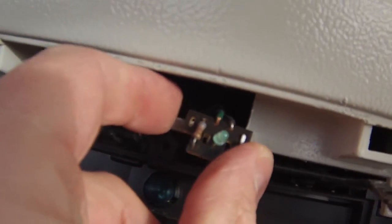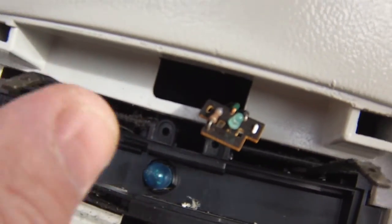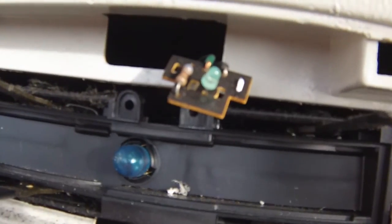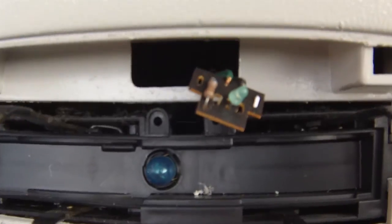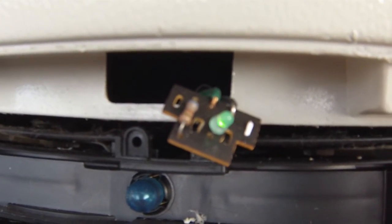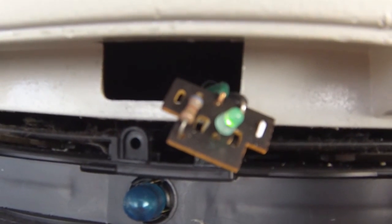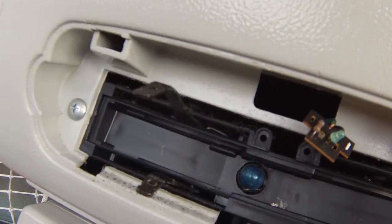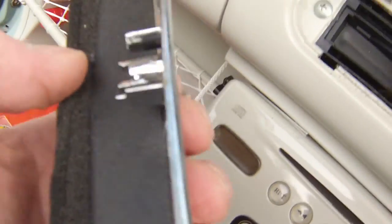Now you can see our little LED there - that's the beast, that's what we've got to change. I'm wondering whether the printed circuit board had fallen back out of the actual assembly. So I've got the car going now and if I flip the switch up you can see the little light comes on - see how dull it is, very very dull. The reason I didn't have a light at all is because this assembly's printed circuit board had actually fallen back and it's supposed to be pushed into this little slot there - it shines through. So the LED was working all along, just very dull.